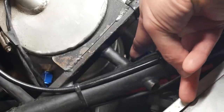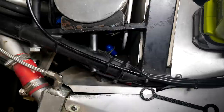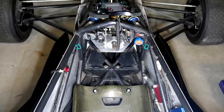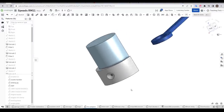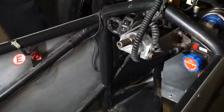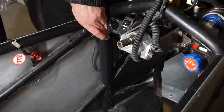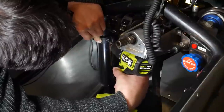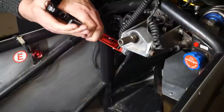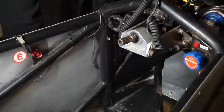It's almost impossible to get your fingers in, so I ended up 3D printing a specialist little arm just to hold the back of the nozzle and get it in place so I could put the front nut on. But no such brackets existed for the other three nozzles, so I was going to have to make my own. The next thing I designed and printed was a little jig to help me drill into the chassis — the diameter matched the vertical section, and it had a flat so it could rotate against the sheet metal and get the right angle. This allowed me to drill pilot holes on equal heights and angles on both sides, which I then expanded to a larger hole before installing a nice shiny M6 rivet nut fitting on both sides.